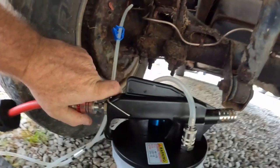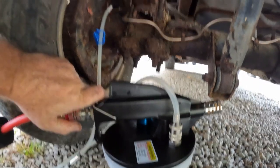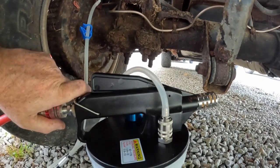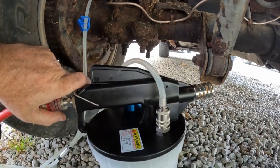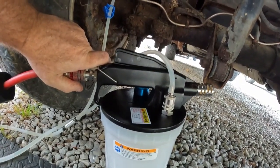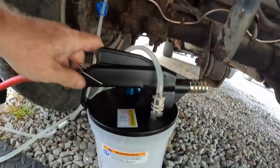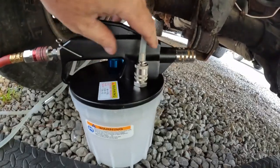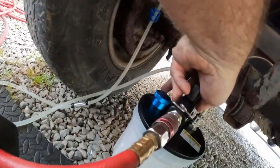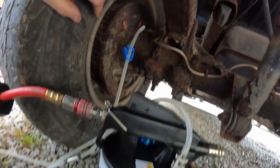Now they do make one that you put over top of the master cylinder that you pump air into, like a pump sprayer. It pressurizes to like 10 or 15 pounds and then you come back here and bleed it — it's just like somebody putting on the brakes. But the master cylinder I've got, you'd need a special adapter which was like $50. It was $80 for the pressure kit and then another $50 for the adapter, so I decided I'd just go with this thing. I think it was $40 on Amazon. It looks pretty well-made. It's got a pot for your fluid, a quick disconnect for your hose, a knob on the other side for draining, and a lock for holding it on. One thing I don't like is when the hose is hooked to it, it won't stand up by itself.